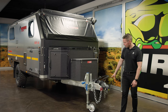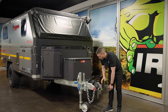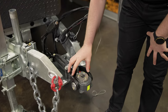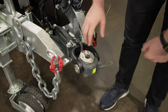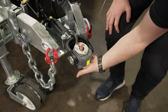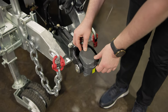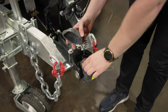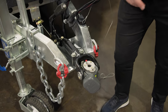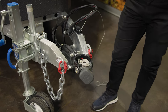It all starts with the DO35 on the front. The DO35 is a very capable piece of equipment that has 360 degree articulation and a unique pin. There's a simple highlighted strip when you're reversing up that helps you know where your pin goes in, and once the pin goes up through the middle it just locks into place. A smart design with the DO35 is that the cover will not secure unless you have it in the lock position. The DO35 pin comes with the UEV 14 — on delivery we remove any existing ball on your vehicle, fit the DO35 pin, and off you go.